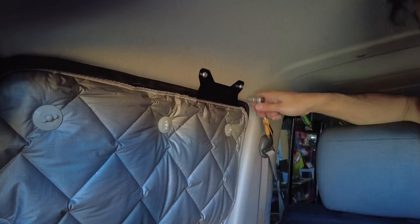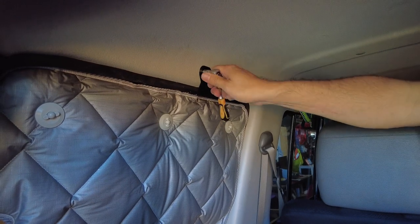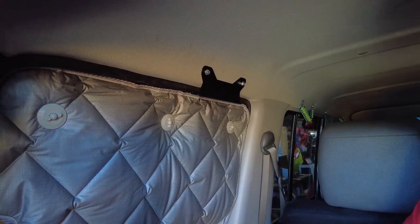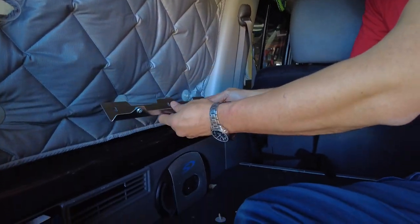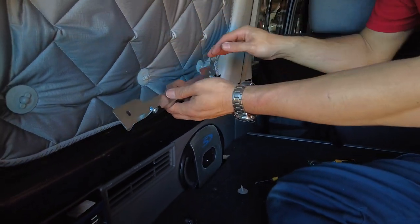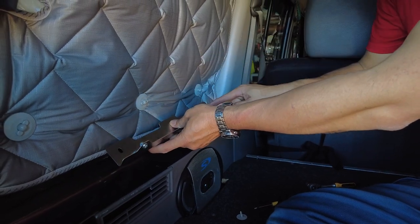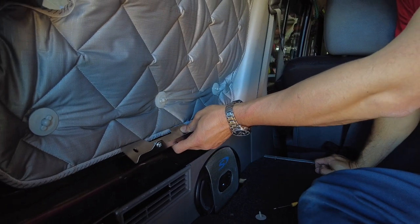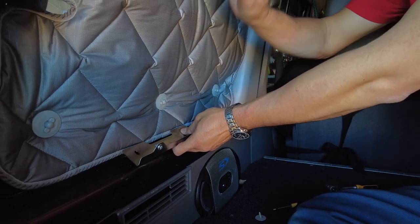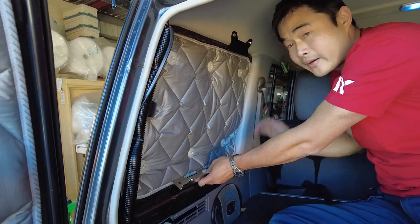Position in the middle and level, and we'll just nip that up a little. Not too tight because we're going to want to adjust the position. Now grab your bottom bracket. This one has three points but that's for the prototype — we've actually realised we only need the two mounting points. So we need to drill two holes for two nutserts in the bottom there. The way we're going to do that is we'll attach this to the MOLLE panel, attach this to the top bracket, and we'll mark those holes. So I'll go grab the panel now.